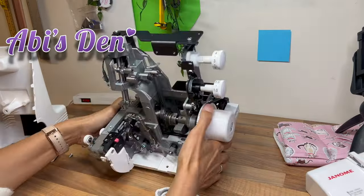So make sure you're using the correct screws. You can see I've got them all piled up on the left-hand side there. But remembering what I showed you earlier, make sure you've got the wide thread for the plastic screw holes, and you're using the narrow ones for where it's a screw going into a metal hole.